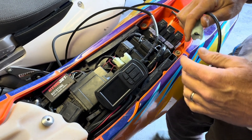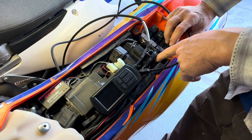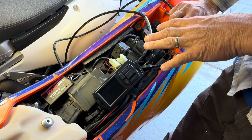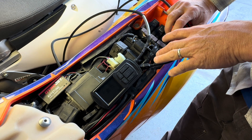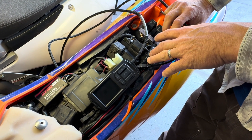Have your unit here at the bike. A couple of things before you start the process: make sure that your bike has at least a charged battery, or put a charger on the battery. This will energize the ECU and draw power from the battery. You don't want to pull that battery down below something like 12.1 volts — you want to make sure it's high, say 13 volts.